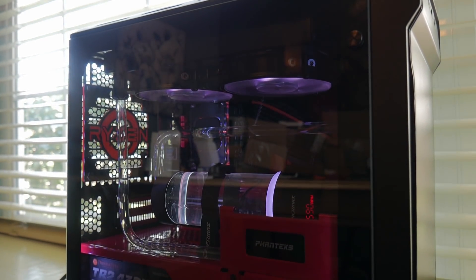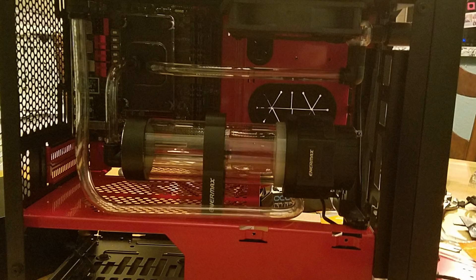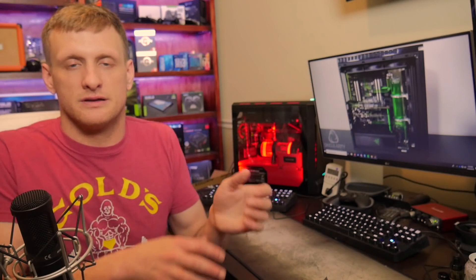The only one that we had to freehand ended up having three turns in it and they're all 90s. But unfortunately, because of the size of the case and needing to go under the pump-res combo there and kind of curve under it, I couldn't really get a good feel for it with using the tools. I did use it to guide for some assistance on the long run, and we kind of just used a little 90 to bend that up and then just heat up the whole entire pipe to kind of make it malleable and get it in place. One of the things that really helps, especially if you're trying to freehand, is to get a heat gun that's going to have a temperature adjustment on it. I'll link one in the description below so you can check that out.